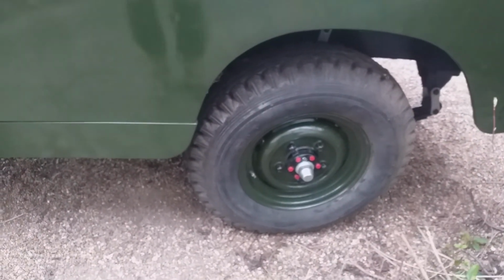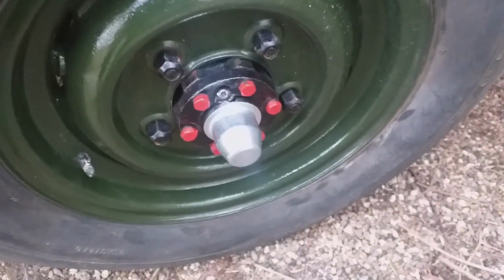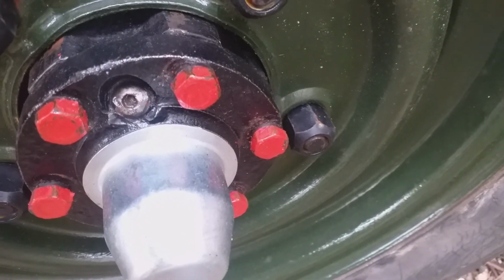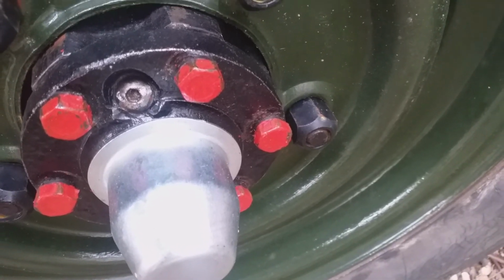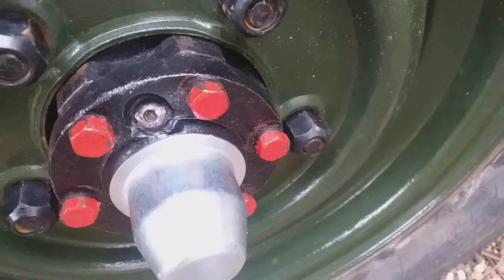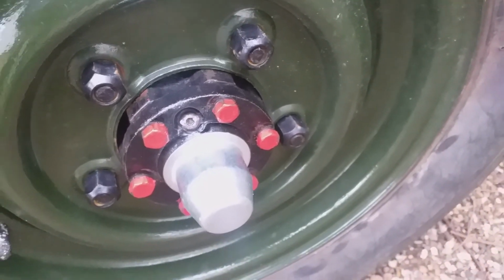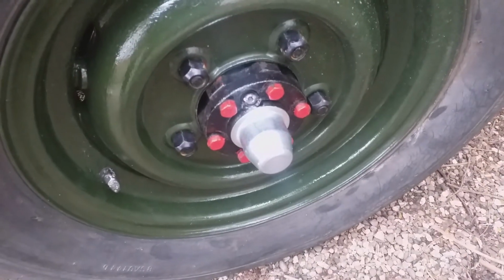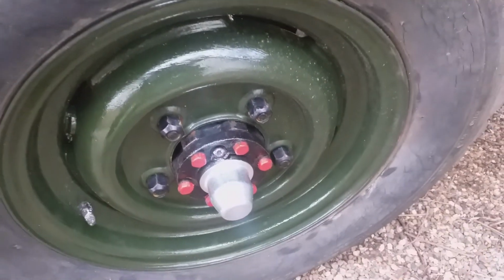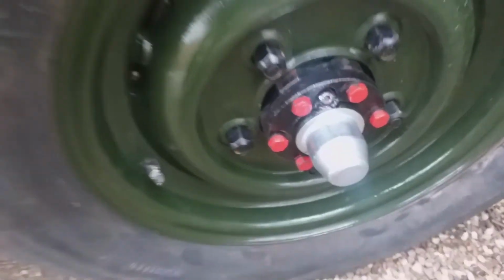Right, time to start an update from the wheel. Now the reason I do an update from the rear wheel is because when I first got this truck, the oil-filled hubs, I mean most of the later ones are grease-filled, but this one was oil-filled, and someone had welded the filler hole. There's the sort of evidence where the filler screw on the driving member was welded shut, and when I took it to pieces, it had an old nail for a split pin, and because it had leaked there in the past, and I kind of fixed it up, I always check to see whether it were leaking. So that's why I do an update from the wheel, because you just like to see whether it was leaking.